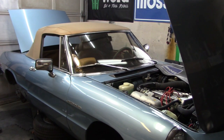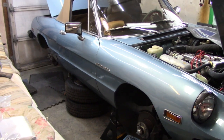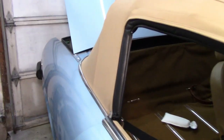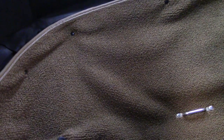Let's get started on the rear shock swap. I've got the rear tire off and just sitting under the car for some added safety. The rear is a little more difficult than the front just because of access - on the interior of the car the rear curtain has to be removed at least partially because there's a little access plate behind it that allows you to bring the shock out from the interior. I'll remove the screws holding the rear carpet and reveal that access panel.